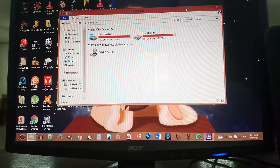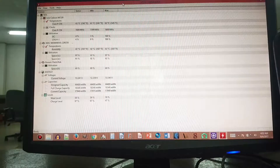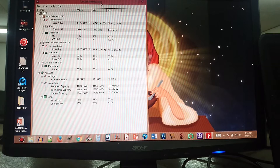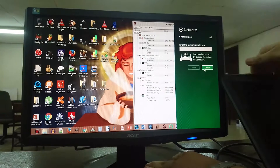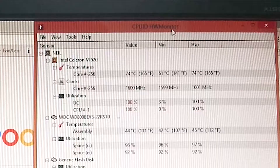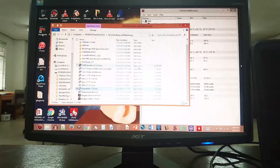There we go — temperature. The Celeron M520 is at 61 degrees, pretty much average for a laptop. That's the same temperature I'm getting on my Core i5 laptop. Now if we move the monitor away — oh, that's why, this thing is the same case as my laptop, it can't stand on its own. There we go. Now we're getting higher temperatures, hitting 74-75.